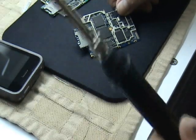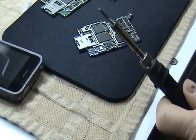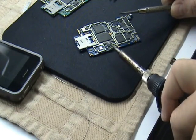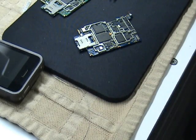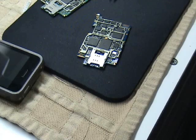Really, the main thing is just having a halfway decent soldering iron. As long as you get a fine tip on that thing — you need a fine tip, not a real fat one — it's going to concentrate the heat. Make sure your tip is real clean too. So that's it right there.